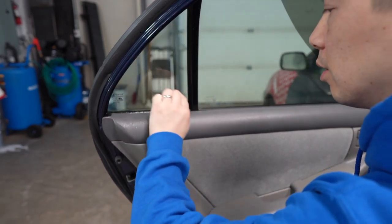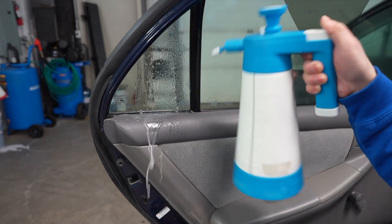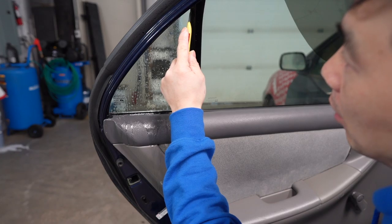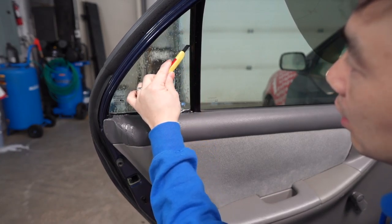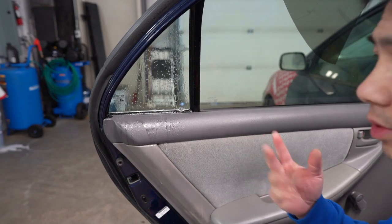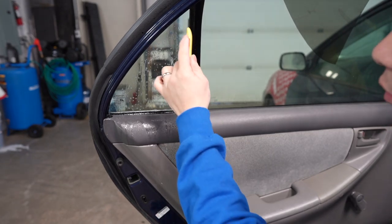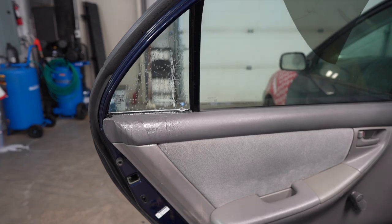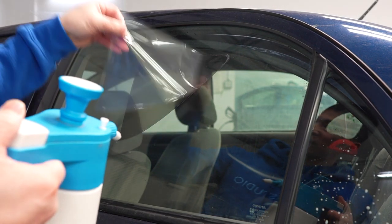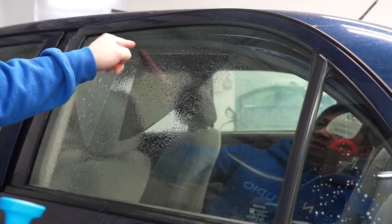The window is fairly clean and ready to install. Spray the solution — not all the way to the top, concentrate on the sides. A lot of installers like to cut the rubber seal here to tuck the film in more easily, but I don't like to trim the seal — I prefer to keep it factory and avoid damaging the gasket. If you're not comfortable you might cut off a little too much. Keep the template you made just in case you need it.